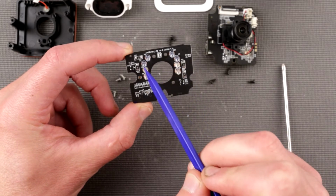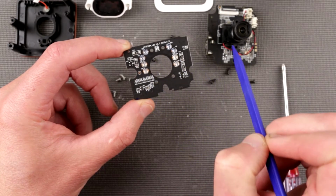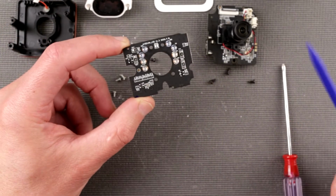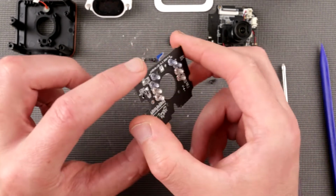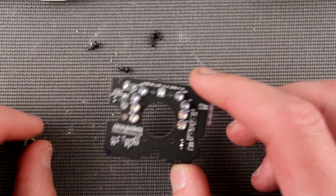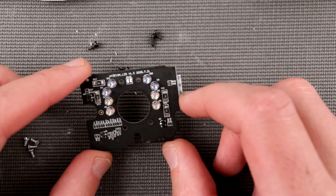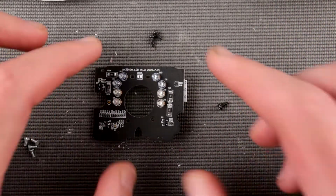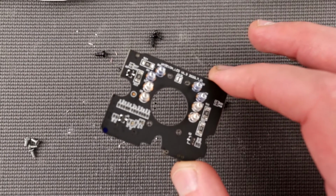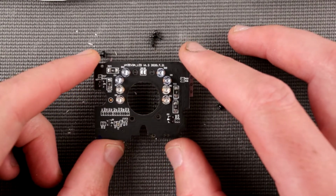This can be infrared, but those look a little bit different in color. I clearly remember reddish LEDs when it is in infrared mode, but those, I'm not sure what they are. Are they regular white LEDs? I don't know, have to double check that somehow. Even if I apply some voltage to those diodes, reverse and forward, there is no light emission. Maybe they are actually infrared LEDs and I just don't see it. Also, it's pretty bright in here. But clearly they have a voltage drop. Anyways, probably I just don't see it. So let's assume those are infrared.